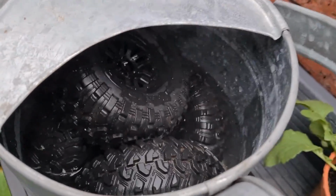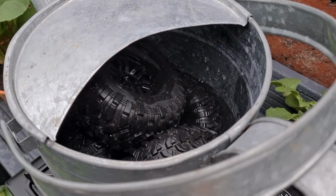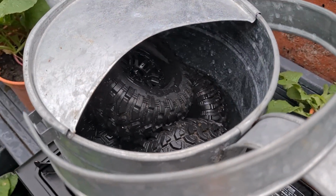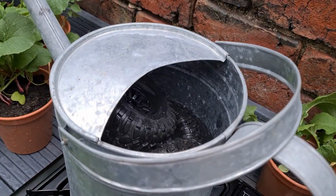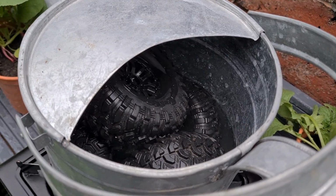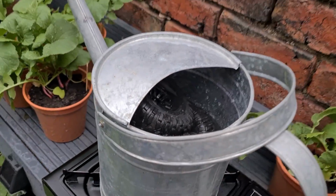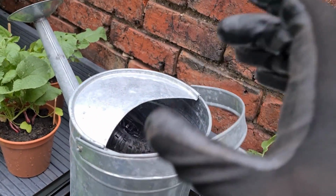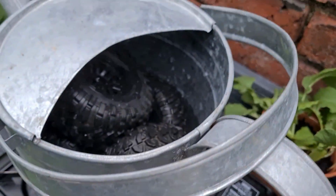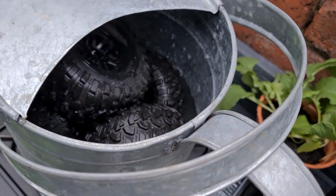The reason, by the way, guys, that I am boiling these tyres off the wheels is that the foams have gone in there completely. The foams have got wet at some point, and they've gone rotten inside and turned to mush. So when we pull these tyres off the rims, you're just going to see mushy foamy bits of foam. What I'm going to put inside here is actually plastic hair scrunchies, bobbles, which again I'll show you in a different video how to do, and glue the bead up nicely on the rims. Let's let these cook and come back in a bit.